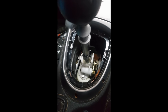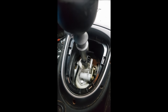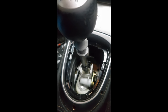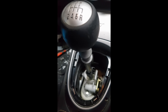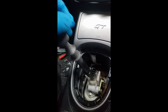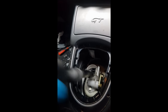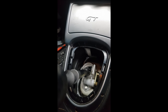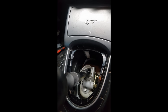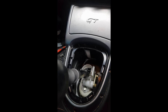I'm currently with this Alfa Romeo GT Diesel — a customer's car in for a gear selector fault. It can't select all the gears; I think it's only getting third and reverse. We've taken the covers off and the selector is a little bit broken and snapped — it shouldn't be moving around there. So what we're going to do is remove the selector and replace it with a good used part.